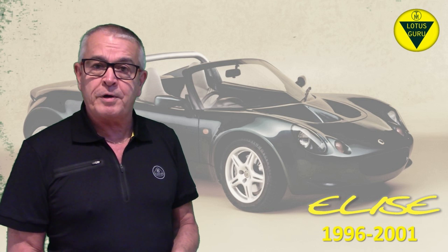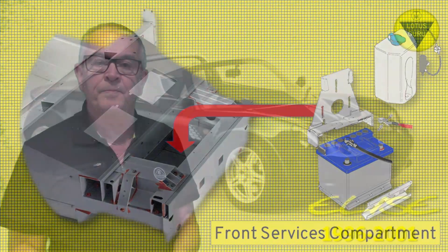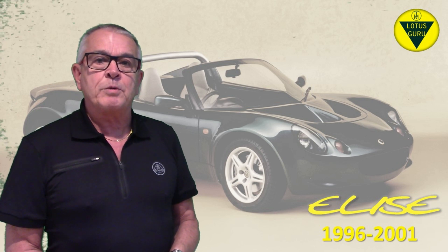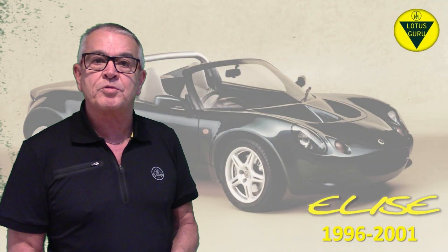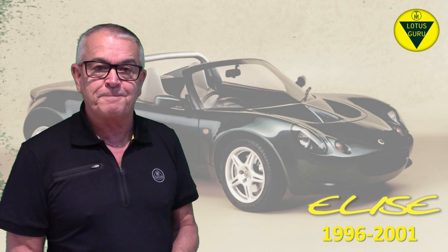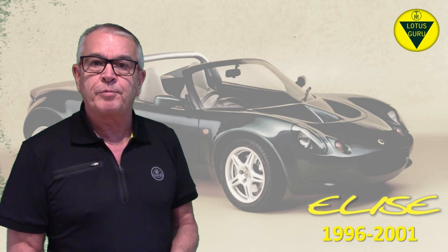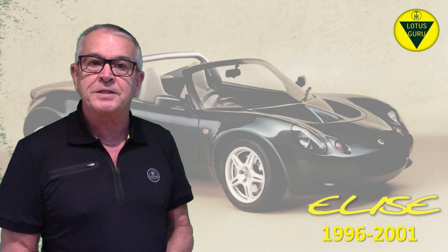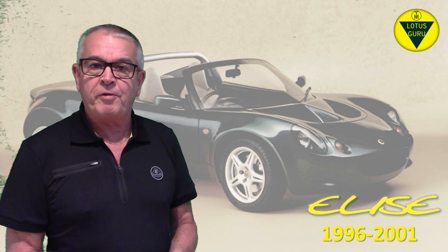Now we'll have a look at what Lotus call the front services compartment. On the Series 1 Elise, this contained the battery, which is retained with a clamp that also doubles as a fixing for the washer bottle — a good example of Lotus's way of using one thing for double purposes. Something else lurking in this area is the front ground or earth point. From time to time a Lotus will experience some electrical issues. These can sometimes be traced to a dodgy ground connection — remove it, clean it, and usually problem solved. The earth stud is located on the left-hand side in the front service compartment, easily accessed once you remove the washer bottle and the battery, but it's not so easy on Series 2 cars — more on that a bit later.